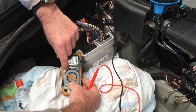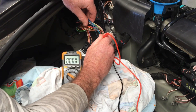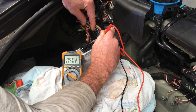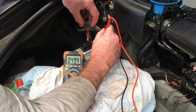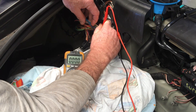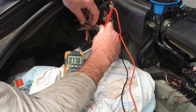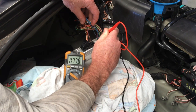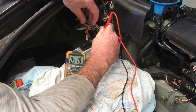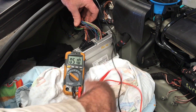Now I'll change that to duty cycle. Distance sensor 1: expecting 50% — and we are. Distance sensor 2: expecting 50% — yes. Distance sensor 3: this is where I'd expect something different — that's about 78%, which is pretty normal for first gear selected. Distance sensor 4: expecting 50% — yes. So they are all perfectly normal readings.